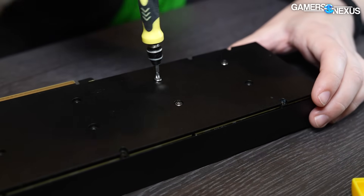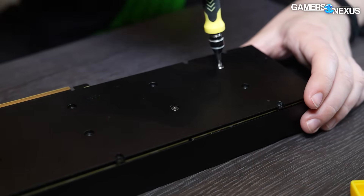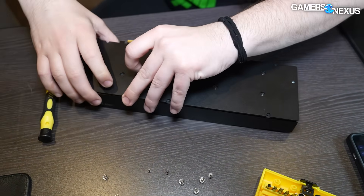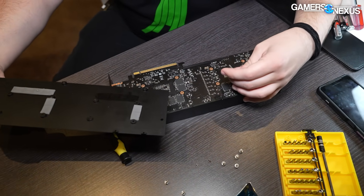The VRM I'm expecting to find is a 6+2+2 layout — so that would be 6 for core, and this is for each GPU, then 2 SA, 2 VRAM. Each in a single configuration, each of these would be 24 gigabytes of memory. We've got one captive screw in there. So on the backside there is memory immediately.